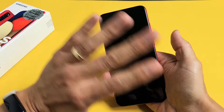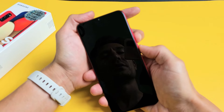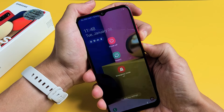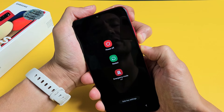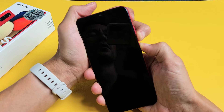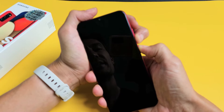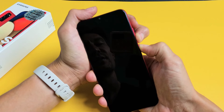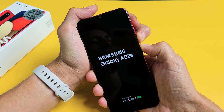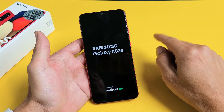Let's pretend my screen is totally black. We'll do it together. Volume down, power. Press and hold both buttons. Don't worry about what's happening to my screen, just continue to hold. I'm just holding the two buttons waiting for the Samsung logo to appear. I just felt it vibrate once — still holding. Vibrate a second time. There's the Samsung logo. Now let go of both buttons. Hopefully you guys are back up and running.